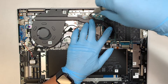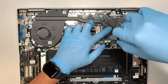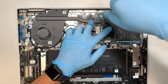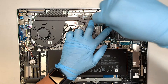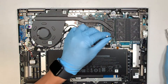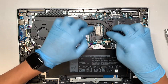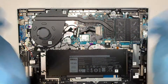I do not tighten all the screws one at a time. What I'll do is give each a couple of twists — I'm trying to put even pressure on all sides rather than tightening one screw all the way at once, because that would push the thermal paste to one corner. So you want to apply even pressure while tightening the screws — work your way around, do one round, then a second round and tighten it up. That way it's much better.